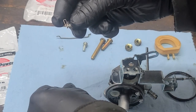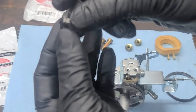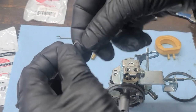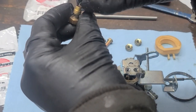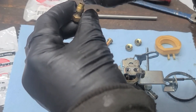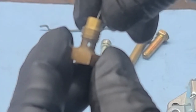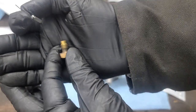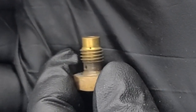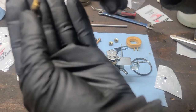We can use the old needle hanger wire to ensure the holes are clear. This is the needle wire that you can bend straight. The first hole is in the middle of the top — when cleaning, you should be able to see through the side holes and see the wire. The other hole is located at the top of the threads and is very small. When clearing this one, you should be able to see the wire through the hole in the top.